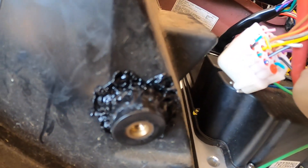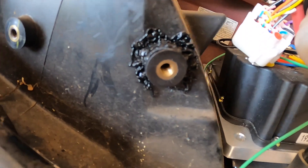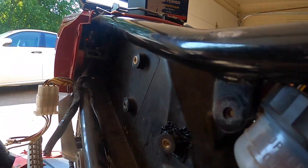If you want, you can sand it down, put some plastic JB Weld or plastic epoxy on there — literally just like a car using Bondo — and smooth it out and shave it down. But for this being on the inside, I'm not too worried about it. This is just to relocate the fuse bracket.